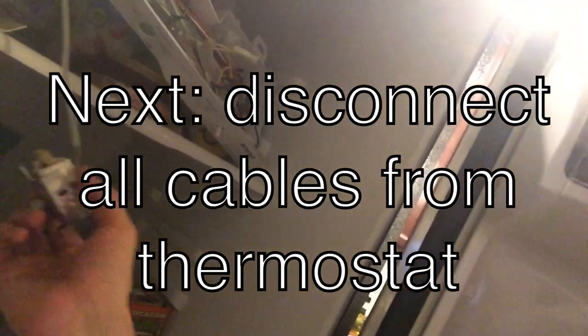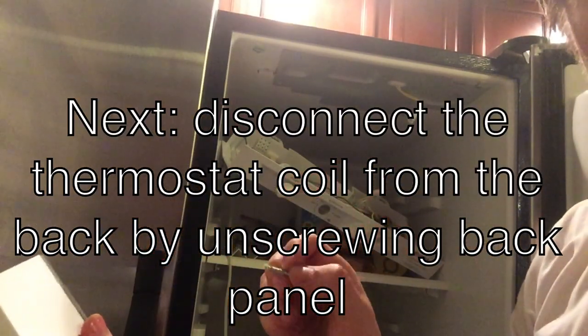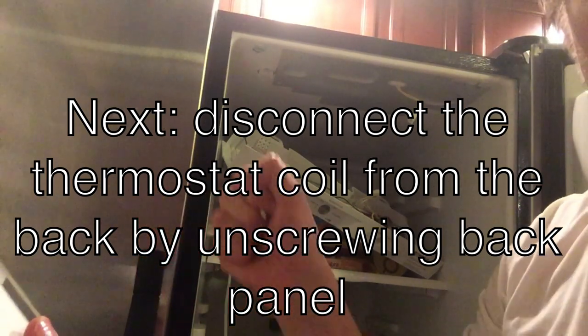In order to remove this, you have to snap the tube out of the back. To do that, you first take out this separate protective piece by unscrewing a screw on the side. You snap it out after unscrewing, and the capillary tube will be wrapped around the side of the area that connects to the freezer. We've now taken this piece out of the back, and we can snap out the capillary tube.